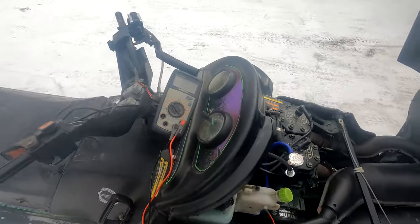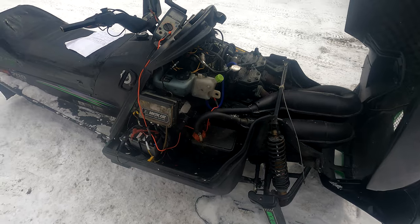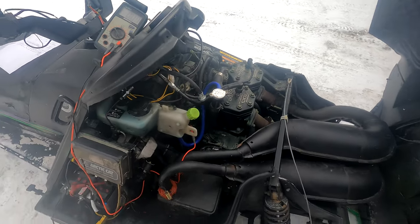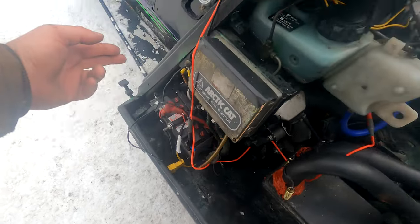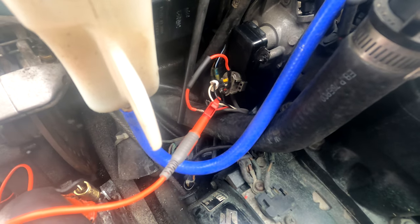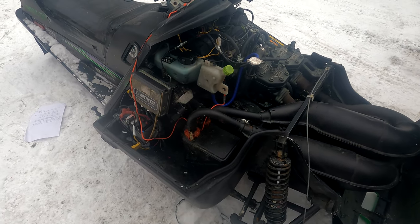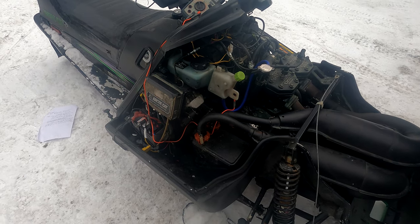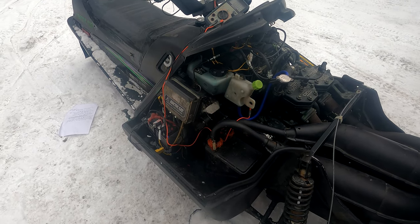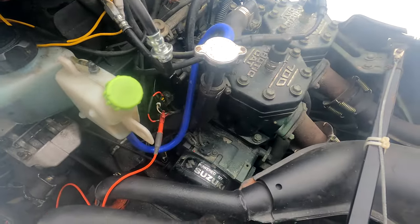This project is coming along — I'm slowly checking all the components. This is an easy way to check your throttle position sensor. All you're doing is running your negative line to your voltmeter and your positive line to the white wire — not the red one, the red one is the feed. This is the best way to test this without a harness. If you have a test harness, that works for a lot of different things, not just the throttle position sensor — you can get one for around 100 bucks. This is a nice quick fix and you've got the true voltage out of the ECU.